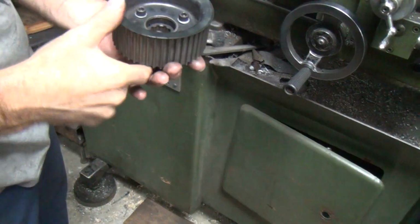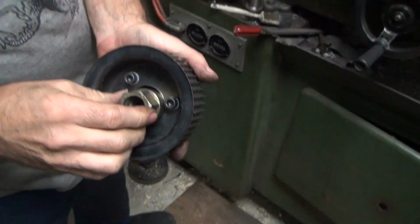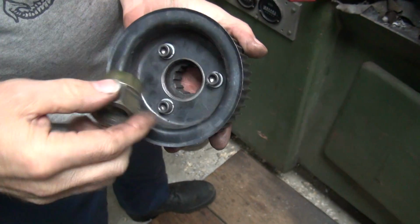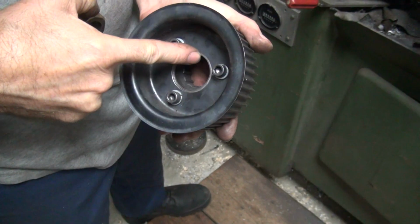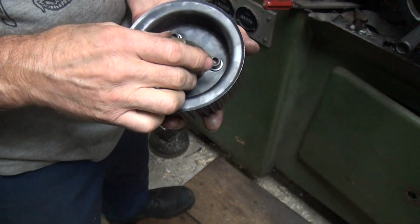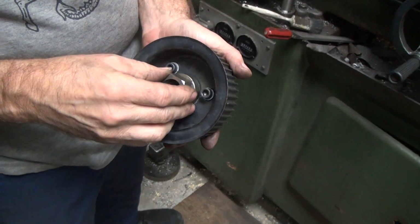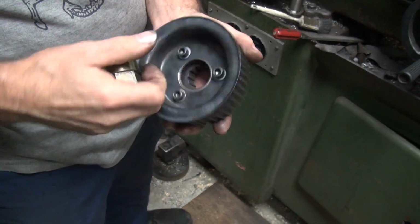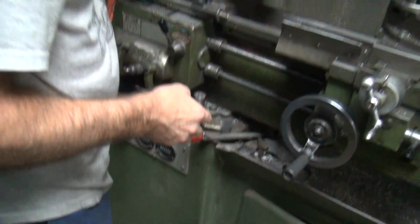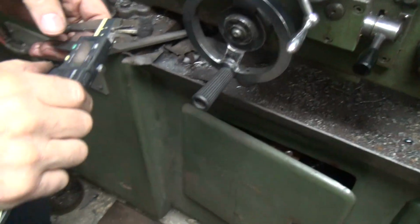Okay, the real problem is this nut does not work against that and not come loose, because it's supposed to go all the way down inside the hole and push on the splines down there and be tight, not up here on this little shoulder, which obviously has no contact to keep that from unscrewing, especially when you're putting Loctite on a nut. So we're going ahead and cut this nut down so it fits down on top of the shoulder where it belongs and be able to torque it hard into the motor. Even though it's all screwed up, we'll still make it work for a few days. Enough to get it out of the house, enough until we get that belt coming in next week.